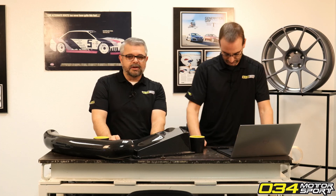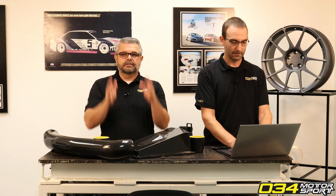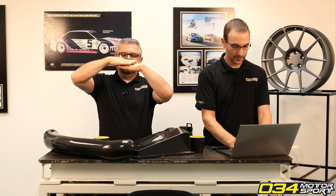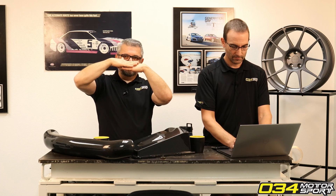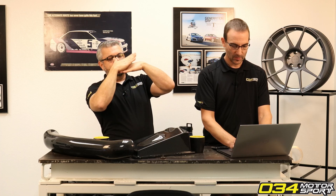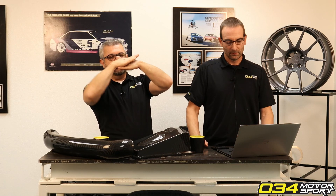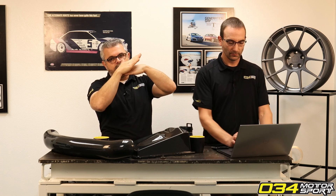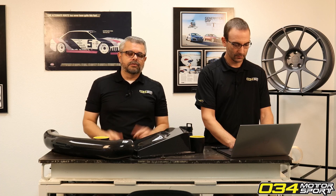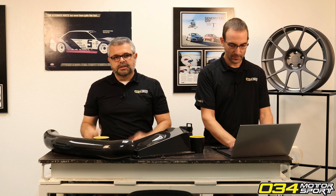Yes, all the above — we made this product for you. You are shredding the outside of your tires because from stock, if this is your contact patch, it's sitting very flat on the road. When you're going down the corkscrew or through any of the turns at Laguna Seca, your car leans, and so your flat tire is now leaning — your entire contact patch is on the outside edge of your tire. Your tire is not designed to work with all the traction patch on essentially the sidewall.